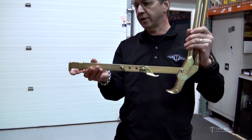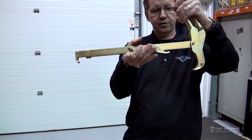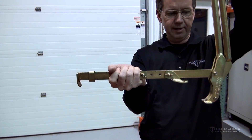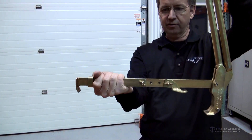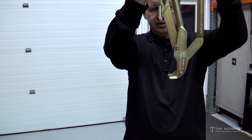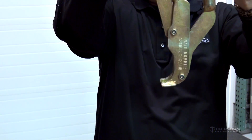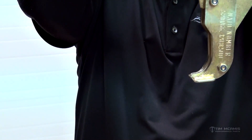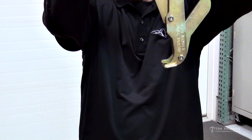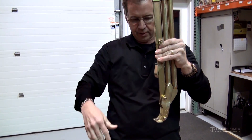This little foot here is going to hook on the opposite side of the rim. These feet here are going to hook 180 degrees across, and then when you pull it in and hook it, you pull it like this and that clamps it in underneath the rim. This is going to stay straight across, but once it's hooked, you pull on this handle — you're pushing on the bottom side of the rim — and in return it's going to drive these little pads downward. So this hooks it, this handle locks it into place.